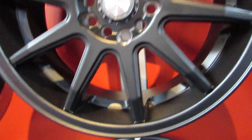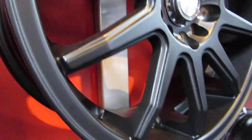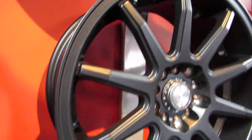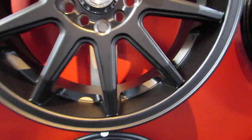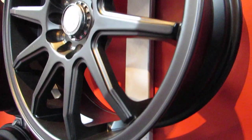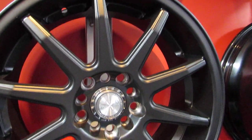Multifit wheels are safe. The biggest question — is it going to shake or vibrate? No. Two things: they should never vibrate because, first, a good tire shop does an amazing balance job using the right equipment — cones, collets — and it'll never vibrate. And the biggest thing I can't stress enough: use hub rings, please. Tire shops, wheel shops — don't get cheap. Make sure you stock hub rings, and if you don't have them, order them per vehicle. Tell the customer straight up: we've got to install them with hub rings, because that's what centers the rim on the hub so it will never vibrate.